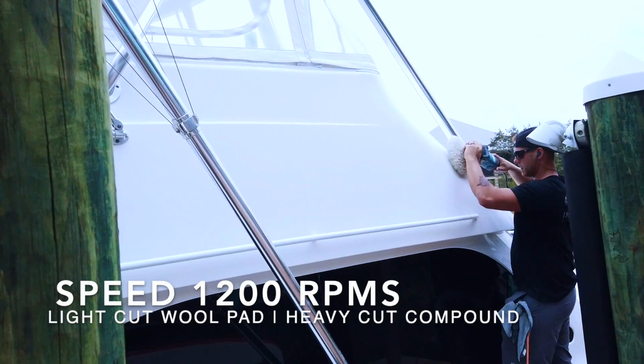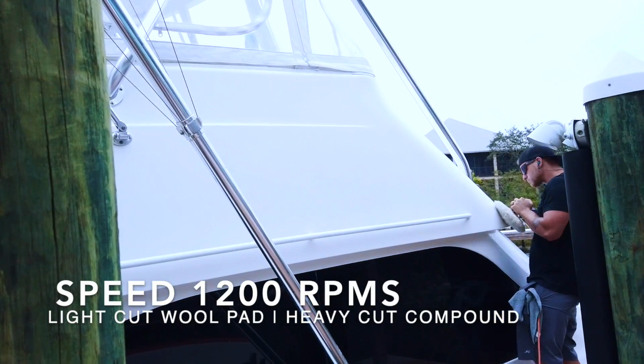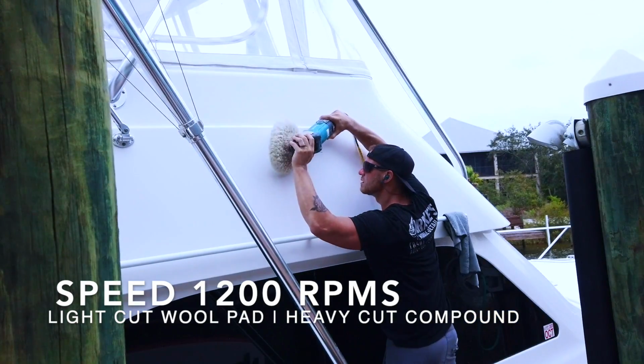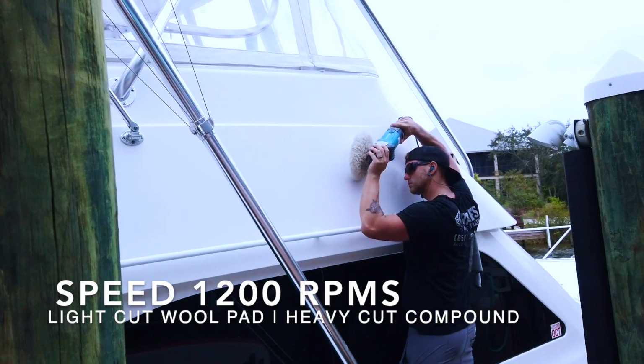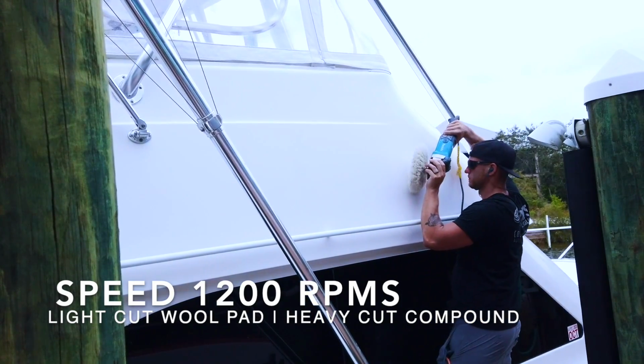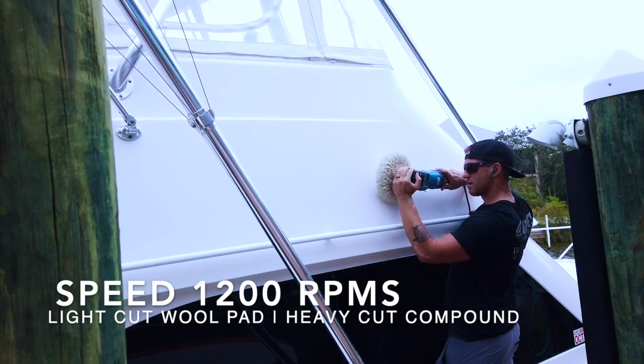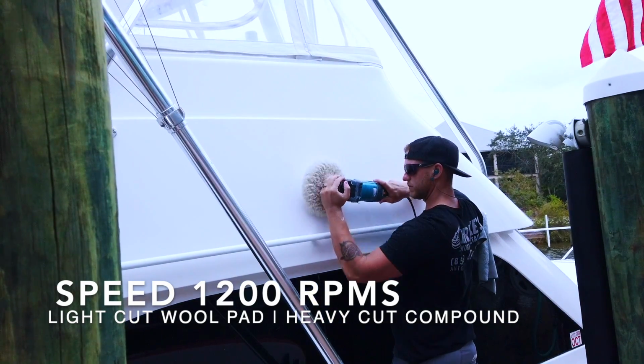So now that it's cut with the Super 6, we're gonna go ahead and move to the same compound, but with a lighter pad. It's gonna remove the scratches from the blue pad. The white wool is gonna remove the scratches from the blue wool. Follow up on these steps one after another. If you have different compounds than what I'm using, your steps will obviously be different. But guys, you don't have to use the same compounds I'm using. I will link them down in the description below. I do recommend it, so you can literally watch this video and follow it to the T.